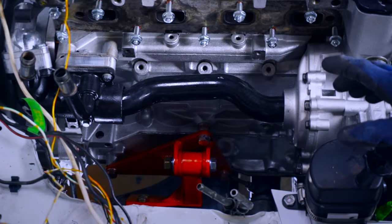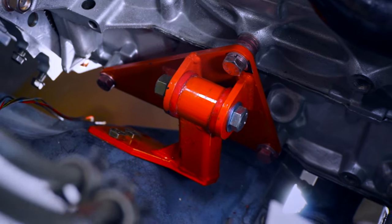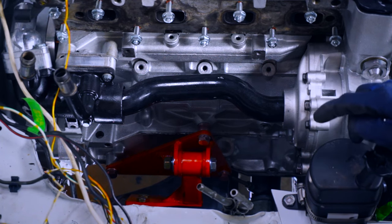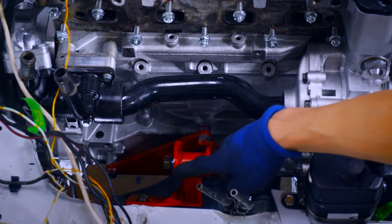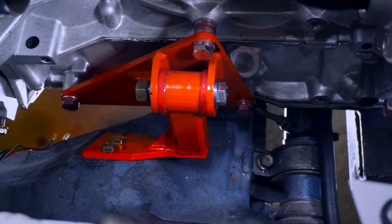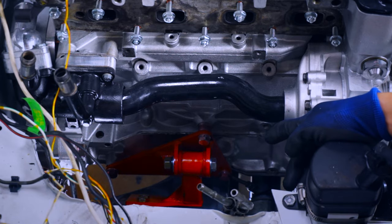Although the Ecotec and the stock Miata motor are a similar package and size, the intake and exhausts run on different sides of the motor. This is the exhaust side on the passenger side of the car, and the exhaust manifold will run here and underneath the car along the subframe. That means the downpipe will pass very close to this engine mount and in extreme track use cases, it can melt this polyurethane bushing.